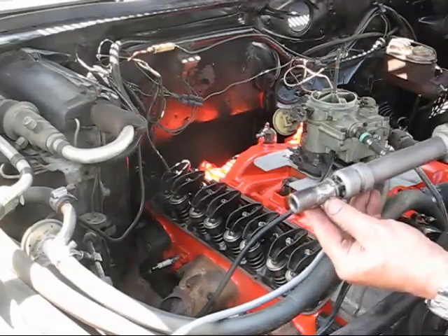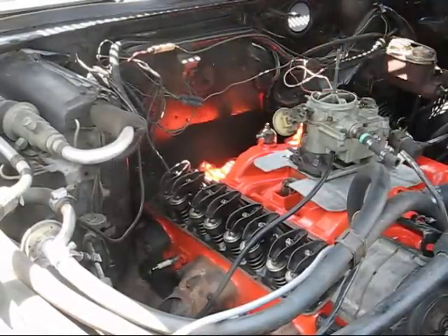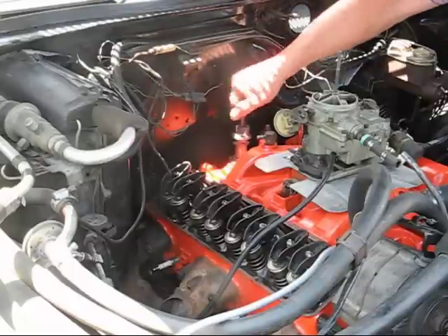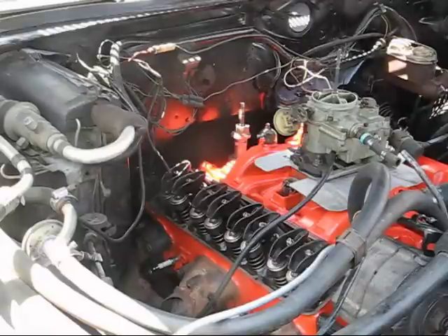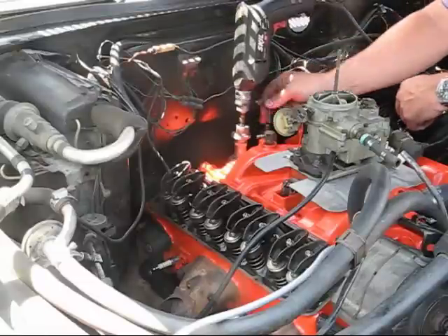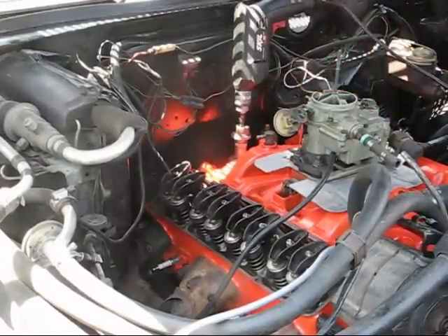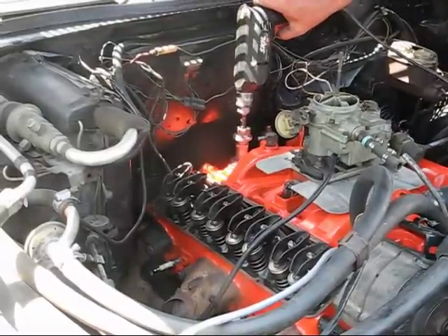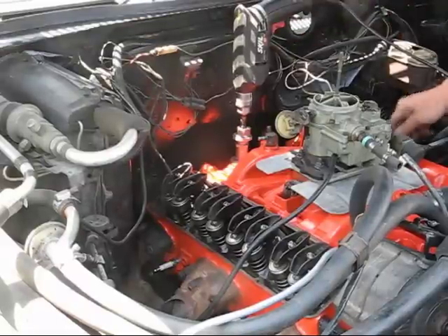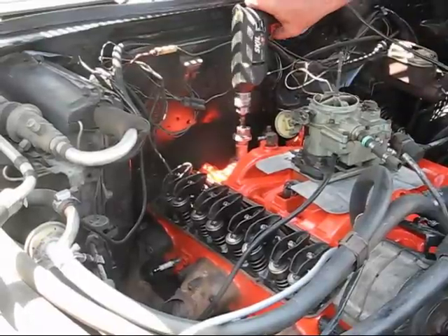Here's an old distributor that they ground off the ends. We're going to put this right there — okay, that's all the way down. The next thing is we're going to put our drill on here and tighten this up. Now the engine is full of oil, and this is running the oil pump just like if the car was running.